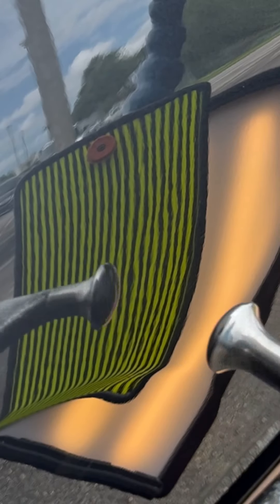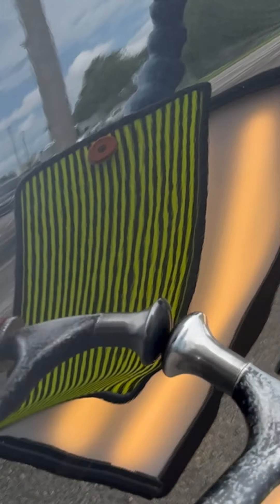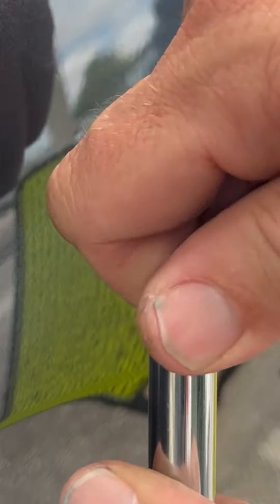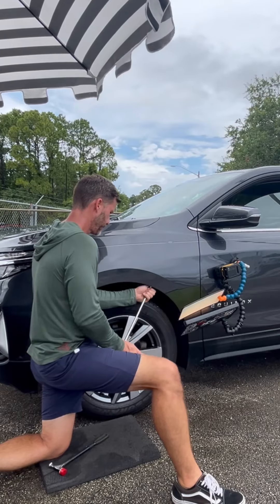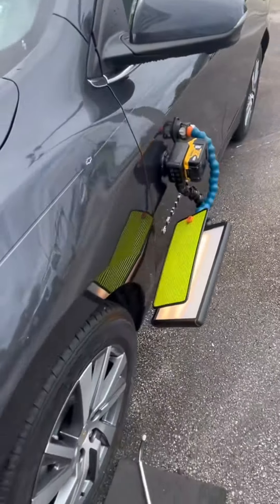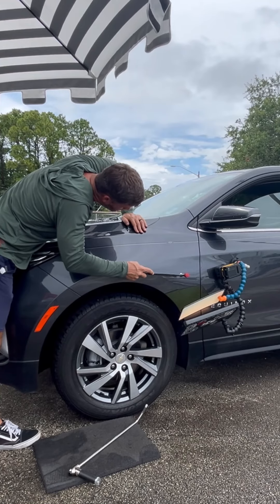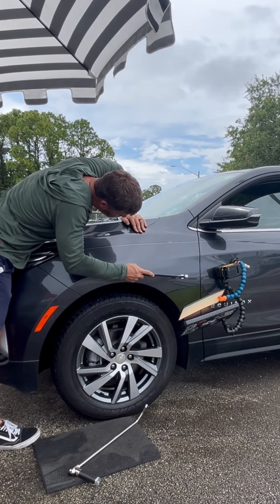I'm swapping that out for the Dent Slayer nylon tip — it is a really good intermediate tip between a big cushion and the metal finishing tip. We're going to go with slow, smooth pushes, working the lows up, knocking the highs down. This trade always comes down to the basics, so if you need to learn the basics, I would recommend the Dent Slayer video training course or in-person training with the Dent Slayer. Now I'm going to get back a little — that's why I'm using this blending hammer. It allows me to get some distance between me and the dent and get a lower angle so that we can do more fine tuning.